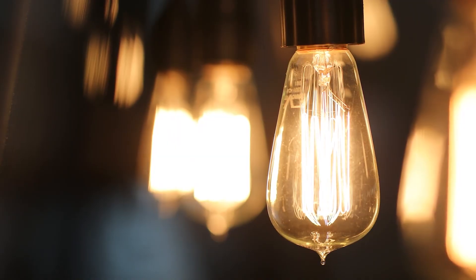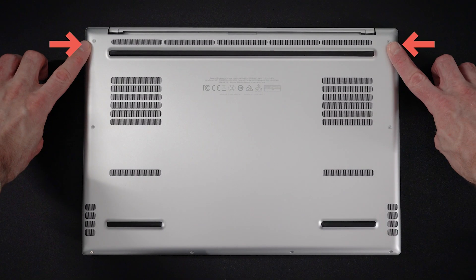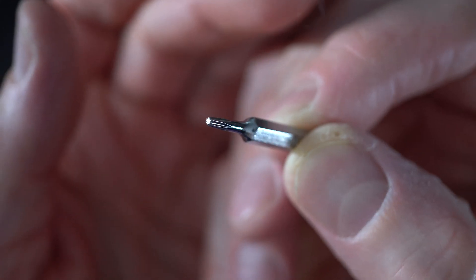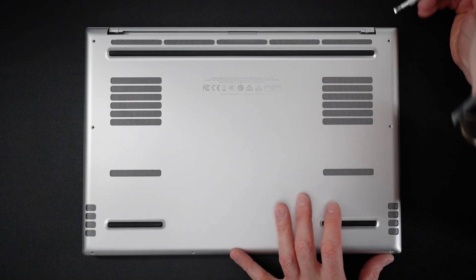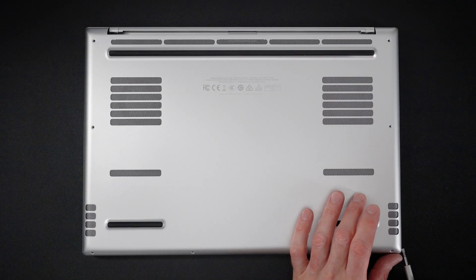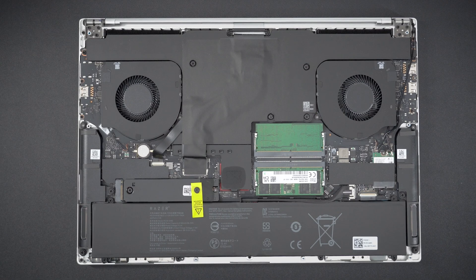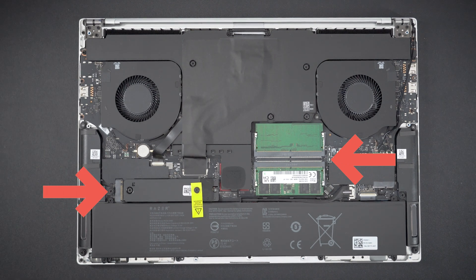Before you open up your laptop, you will need to shut it down properly — not sleep mode, not hibernation, or any other not-quite-shutdown mode — shut down fully. Then flip over your laptop. The Razer Blade 16 has eight M2L 3.5 screws spread across the back cover, so select the right screwdriver tip and remove all of those screws, then simply lift the cover off the back. You may need a flat screwdriver to pop off the edges — be gentle so you're not breaking anything. If it's too stiff you probably missed a screw. Gently lift that off and you should immediately see the RAM slots right in the middle of the motherboard and the M.2 SSD slots down the bottom left.